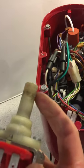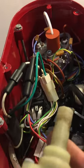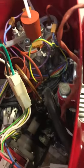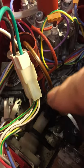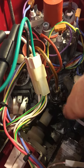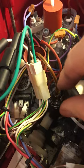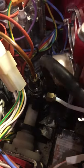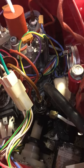This end here is threaded, so once you've got it, you can twist it to remove the pump. Because mine had quite a lot of limescale on it, I removed the 10mm fitting here — I removed this pipe and this pipe — and pulled that section up, gave it a clean, and I've put some silicone around there to seal it.